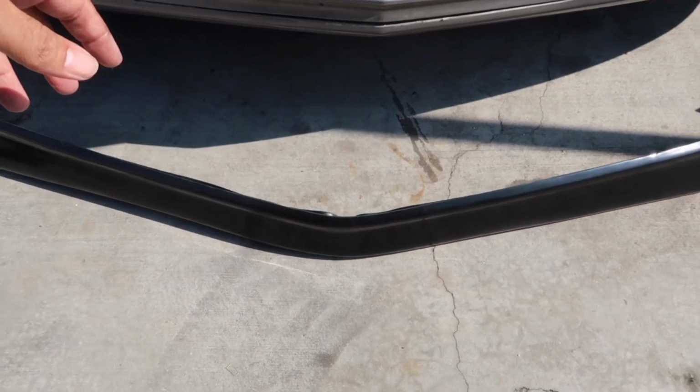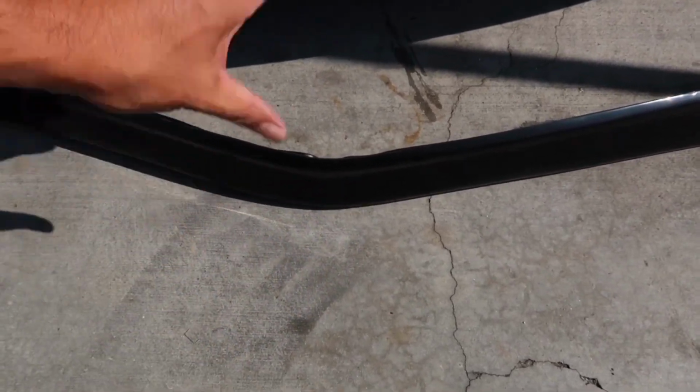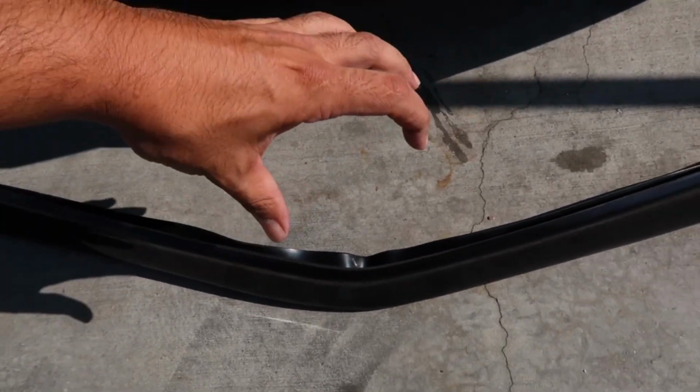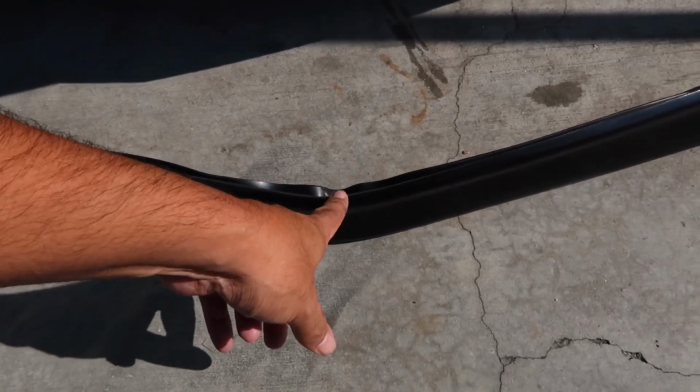So what I ended up doing, I took it back home and put it on a space heater, because, you know, old 1920s apartment, there's no AC or heater. So we have these little heaters. I put a bungee cord from a hole right here to a hole right there, pulling it this way, and I was forcefully pulling it, and I heated this up to at least 150 degrees where it melted it. So that's how I got this contour.